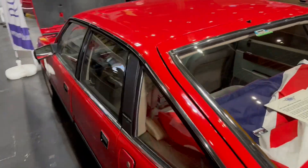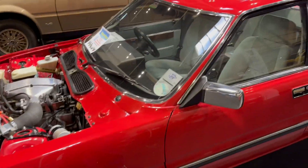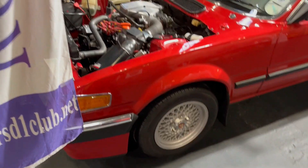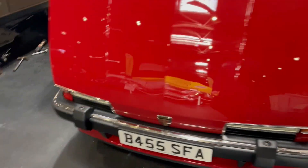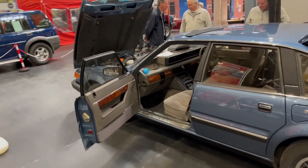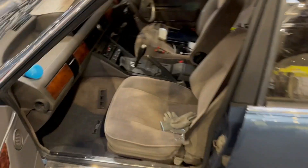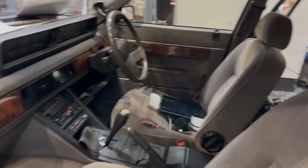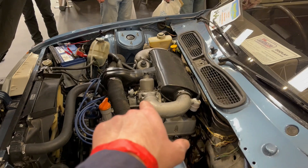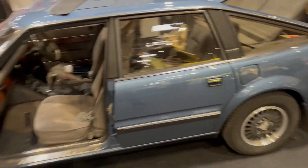That's a three-and-a-half litre fuel injected V8, 190 horsepower, Lucas flapper fuel injection, manual box. Vitesses have the 15-inch lattice alloys, the bigger AP twin four-piston calipers, vented discs. My own V8S has the funky headlight wash wipers, which don't currently work but will do, and black bumpers. Then this is Nigel's - an 1985 twin carb V8 auto in Vanden Plas spec, so it has the nice comfy seats. I'm not sure this one has aircon, but it's got pretty much everything else extra. Like my police car, it's got the electronically controlled V8 twin SUs with a stepper motor on the side run by an ECU to operate the chokes - quite advanced for the time. That technology later went on to the Montegos, Maestros, and even Minis of the era.